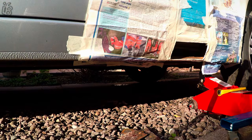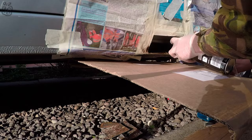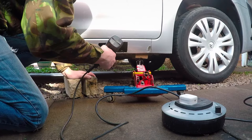So we're going to be spraying this — this was the underbody spray. Hammerite, I believe it is, and it says it's got the wax oil applied to it. So I gave it a good two, three coats in there, left it overnight to dry after sealing it up. I just placed a little polythene bag over the opening. The following day I applied a little bit more heat just to make sure it was dry and any other moisture that may have got in there was evaporated.